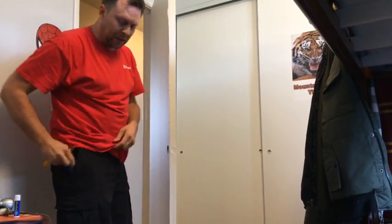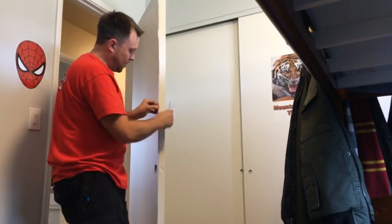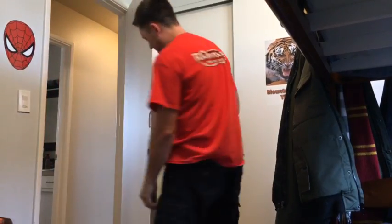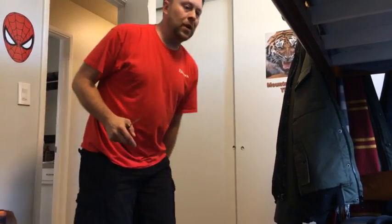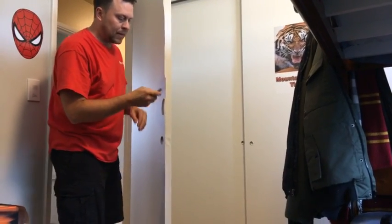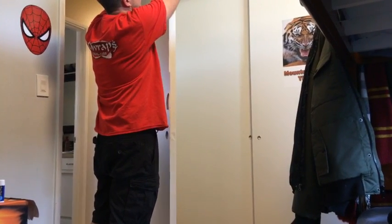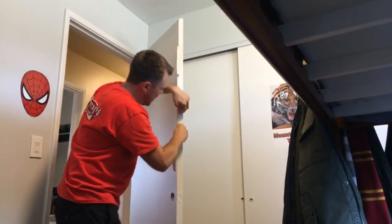For the door wraps, you can grab the knife and go right up to the edge and just cut right down. But the bad thing about that is, over time when you're grabbing the door or walking by and doing a lot of rubbing, the edge will lift up a little bit. So the best way — I go about a quarter inch in and I cut all the way down. I'm using my thumb as a guide on the door itself.